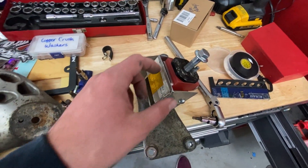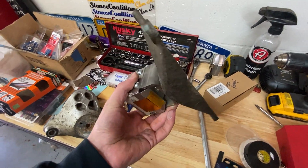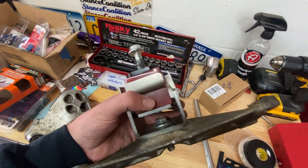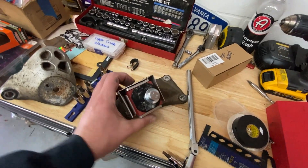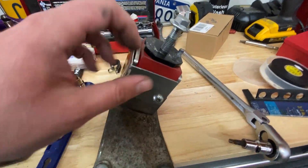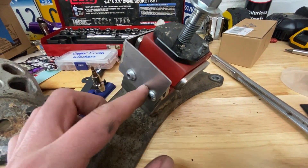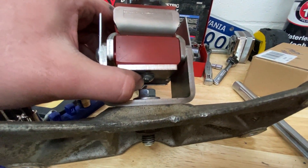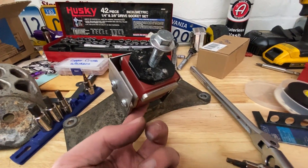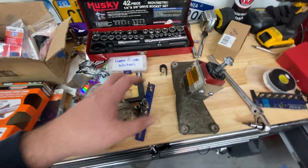The red V - I was just here tinkering with these Creative Steel rebuildable race motor mounts. I ran these for about two months in the black V. They're very stiff with a lot of vibration from the cam, so I pulled them and put the UMI mounts in instead - also polyurethane but a softer street mount. When removing them I twisted one piece, but since they're rebuildable you just pull the allen bolts out, break it down, re-clock it to the proper orientation, and tighten it back down.